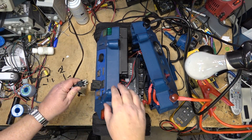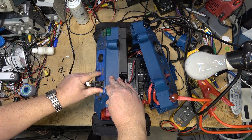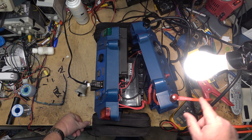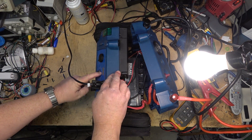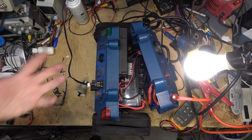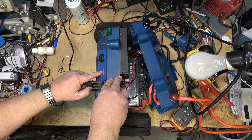I've put my 100 watt bulb from my dim bulb tester in - and there we go. It's telling me the battery is about shot - this battery is not charged and it's also old. The battery voltage has dropped down to 11 volts, 10.9 volts. I'm not drawing as much current now so the battery voltage has gone back up to 12.2 volts. When it gets down below 12 volts is where it's going to start to beep - at 11 volts, 10.9 is where it's going to start to die.